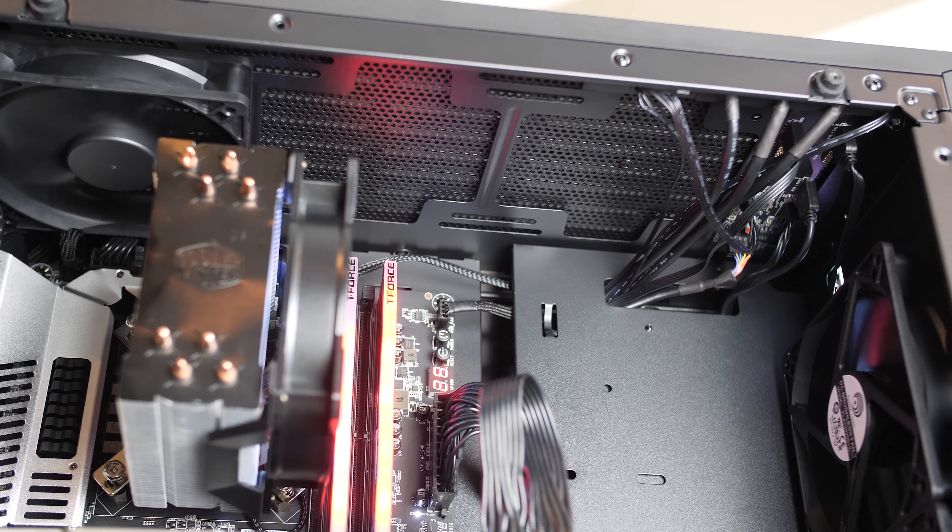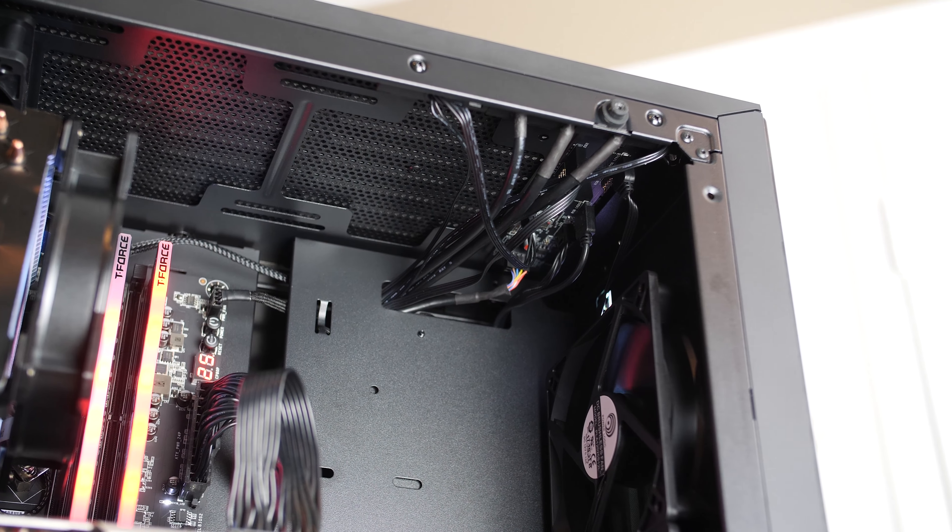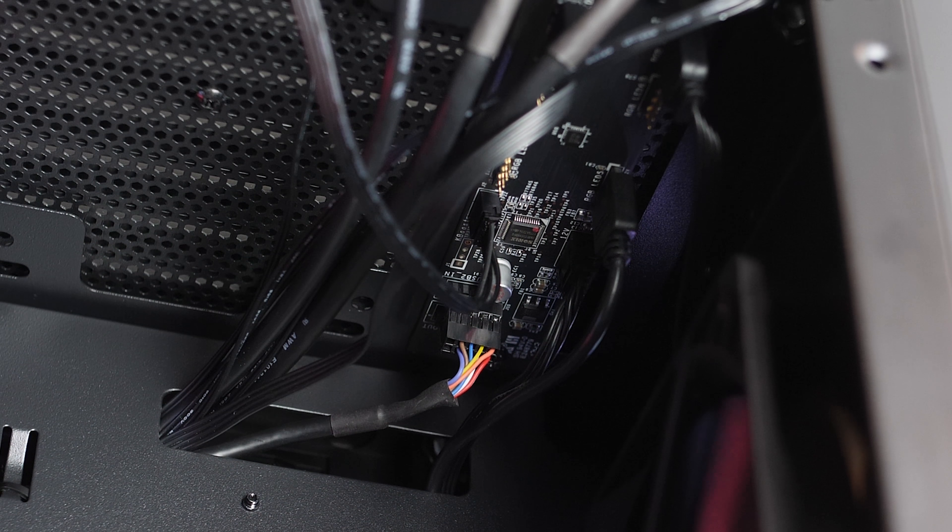On the underside, there's room for a 240mm radiator only, and that's because of this cluster of cables at the front of the chassis. These feed the I/O, but also connect up to the RGB controller hub that's built into the DG-77. The lower-end DG-7s do not come with this. You can connect your fans or other RGB peripherals and control them through the DGTuner software, which has a fairly simple interface. However, there has to be a better way to cable manage this area, as you're effectively eliminating space that could otherwise be used for cooling. Perhaps moving this to the other side of the tray would have been a better solution, as we see with many included fan hubs.